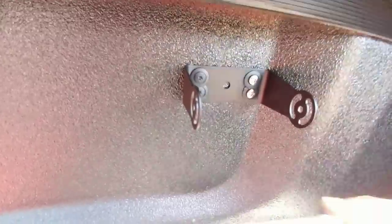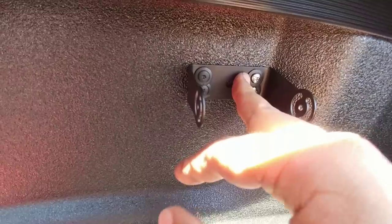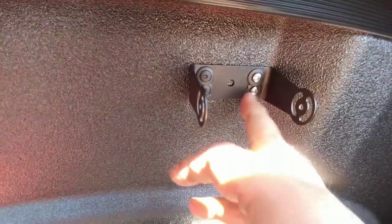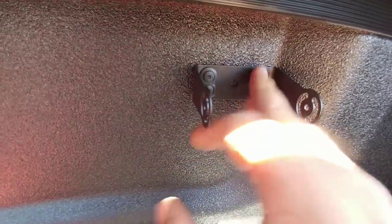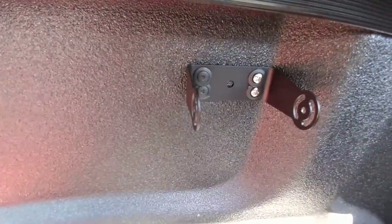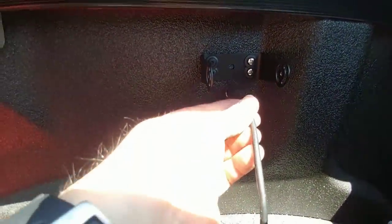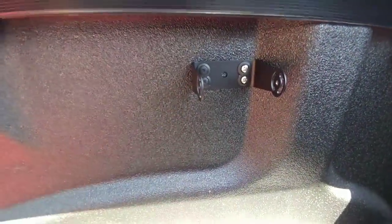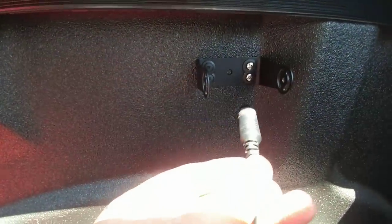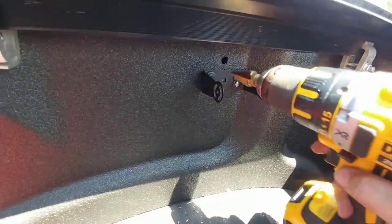Something I had to do that was a little unexpected: two of the screw and plastic pieces went right in but the other two didn't — I couldn't get them to go in without stripping the head. So instead I'm using those as insulators to prevent metal-on-metal contact and I used stainless steel screws in the center to fasten them in place. That's holding on really well — this thing's not going anywhere. One final hole I have to drill will be for the plug coming off the back of the camera, routed above the bracket so it's more concealed and less likely to catch on anything.